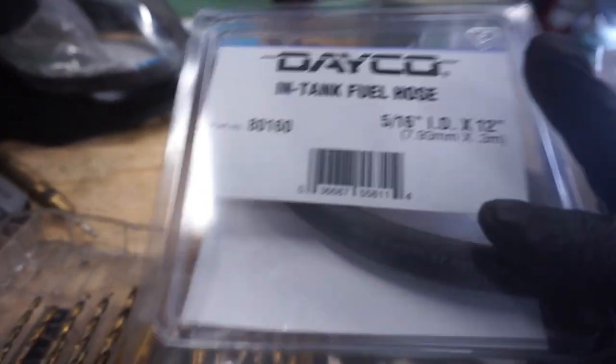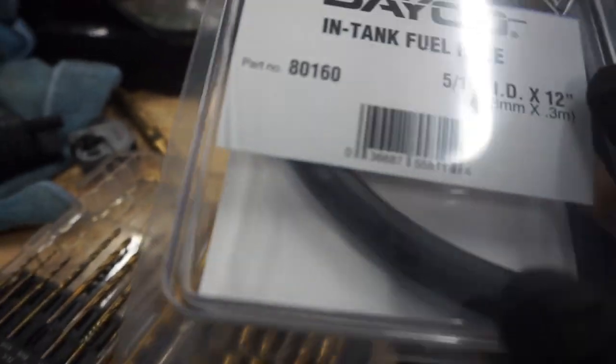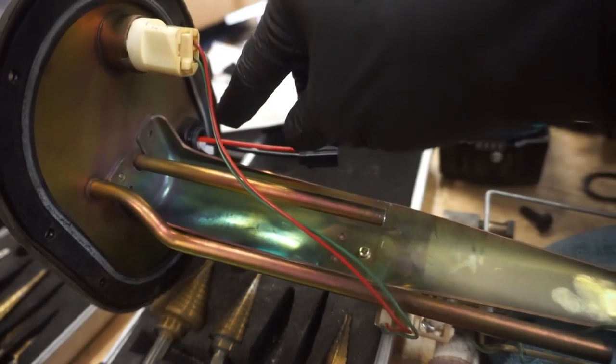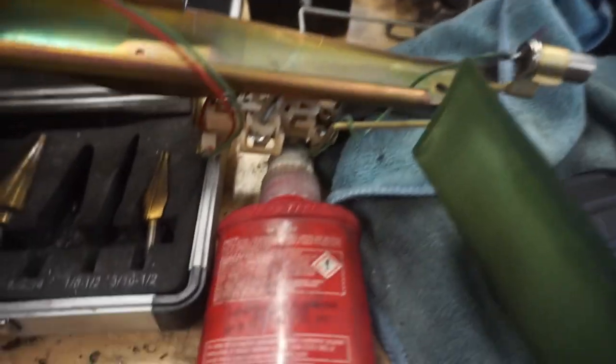You don't have to use the part numbers that I have listed in the description below, but it'd be highly advised, because there's no reason not to. Why innovate? Anyway, so now what we're going to do is put the fuel pump back on the hanger. We're doing this after we drill the holes because metal shavings. As you can see here, the wire is ran through, and we're going to lengthen this out once the fuel pump is back on. So we'll put this back, lengthen the wires out, and then we'll start doing some electrical stuff.